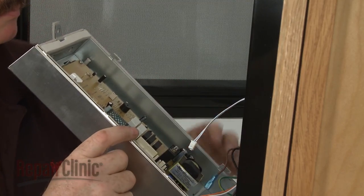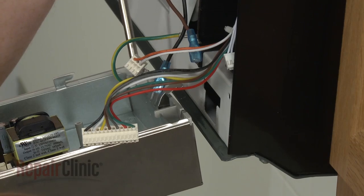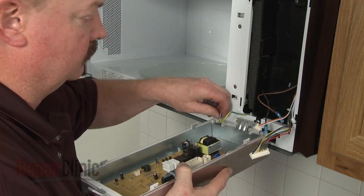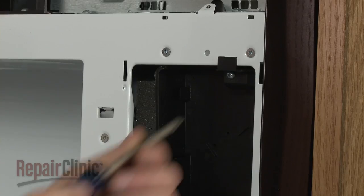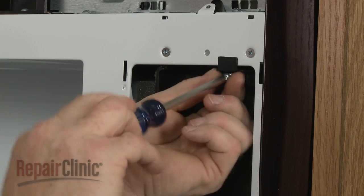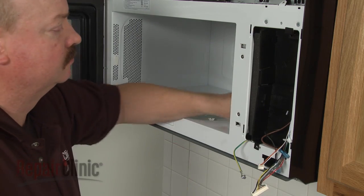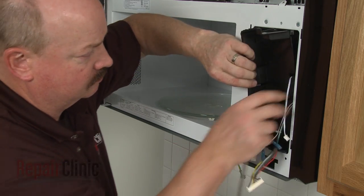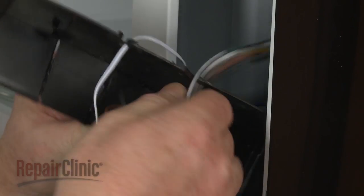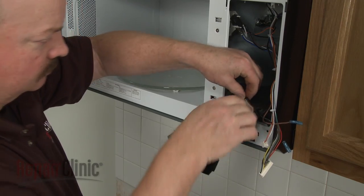Free the hinge tab from the front panel and remove the screw and washer securing the grounding wire. Next, remove the screws securing the plastic control panel backing. Detach the control board wires from the channel, then release the sensor wire and set the backing aside.